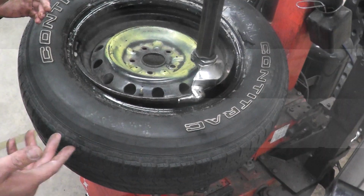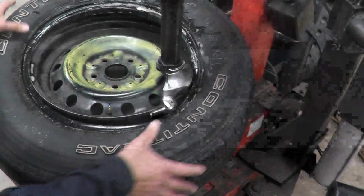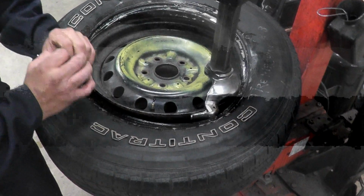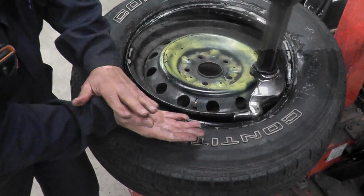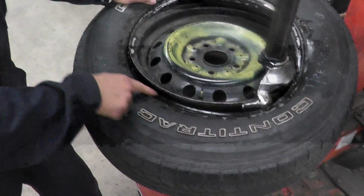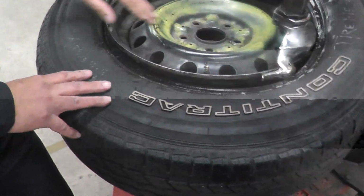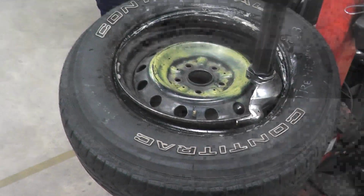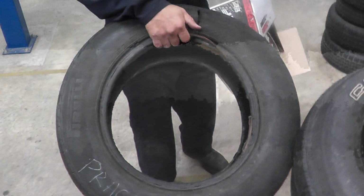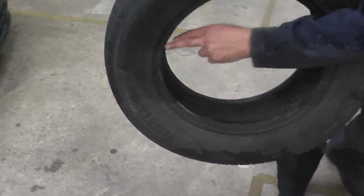We're ready to put the top, same deal, put it on the tail side, spin it as much as you can to turn it clockwise, and this is where it becomes very important that you push the tire where the smallest diameter is, what I was showing you earlier. So if we leave the tire sitting the way it is and I start spinning it, it's going to rip the bead. Okay, and you can see that on the demo other tires, practice tires. You can see the condition of them, and that's what happens if you don't push it below.